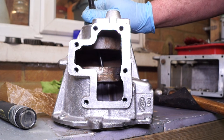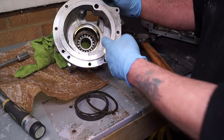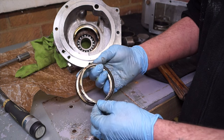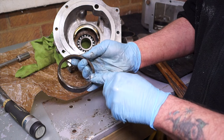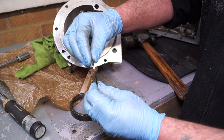You need to strip the front housing down to be able to set this up. The bearing race is in there. Basically what you're doing is knocking the bearing race out, and there is also a spacer in there as well. The shim is vitally important for setting up the bearing preload. So the housing here, we have the bearing race and the shim — make sure the shim is not damaged. And the bearing — we can get the numbers off to make sure we match the bearings correctly.